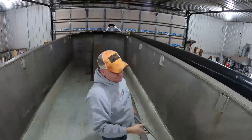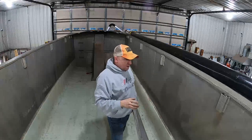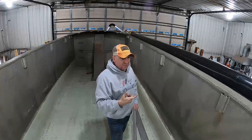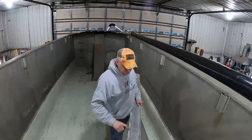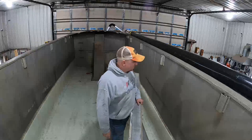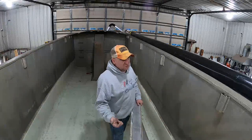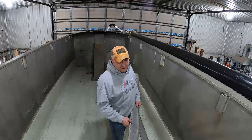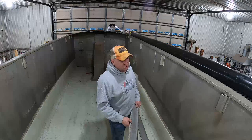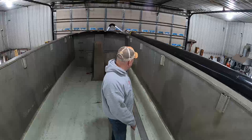So most of these cover straps are held on by quarter inch bolts that go through, but in the ribs of the trailer, there's some self-drilling screws that hold them in. So what I'm gonna do is put the silicone on here to seal them in good. And I'm just gonna put those self-drilling screws in first. And then I'm gonna try to see what I can do to get the other bolts in as well.